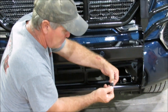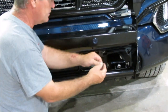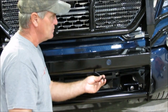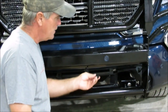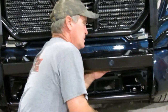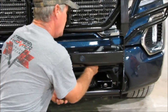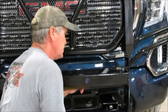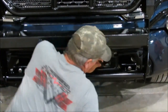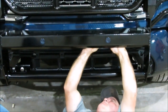Right there, there's a little spot that you can push down — that's kind of how you take it loose on your factory sensor too. There's a little red clip you pull back and then you push that down and it unplugs. All you have to do is use this as the extension because your factory housing extension is too short — it will not fit. So this is made to just extend it out. Once you do that, there's going to be a little extra slack in that extension — just push it inside there and get a zip tie to take the slack out so it's not rattling around underneath. Snap it in and you're done.